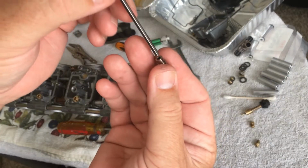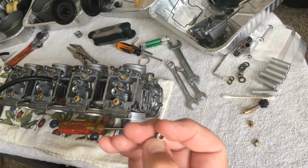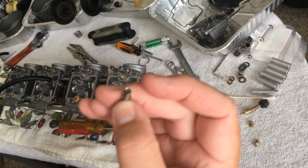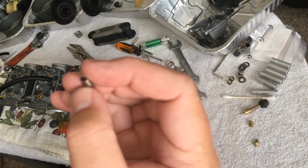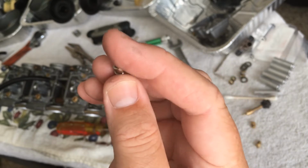this side. A friend of mine had a Suzuki 1100 cruiser bike, I don't remember which, a Shadow, that's what it was. The guy who had rebuilt these sold it. He couldn't get the bike to work. It would only work on choke and wouldn't work on anything else. What he had done, when he took them apart, was flip this over, or somebody did, in the two carburetors. And it just wouldn't work.